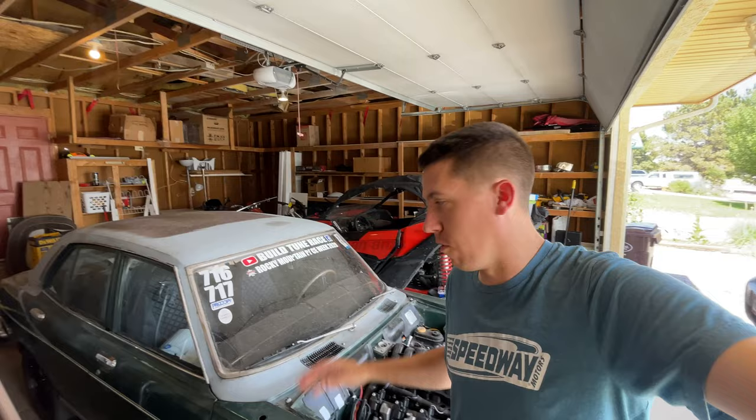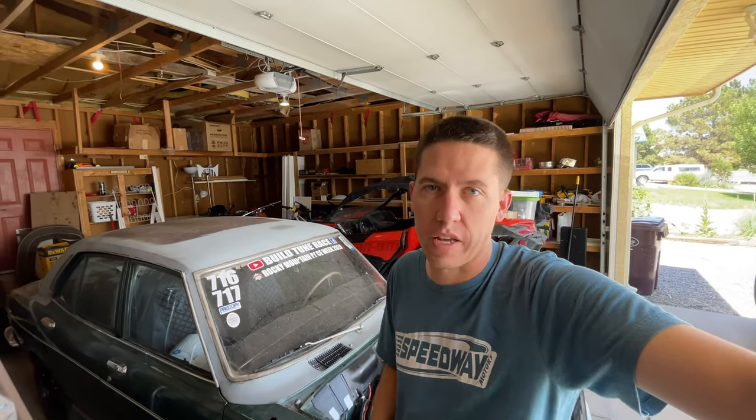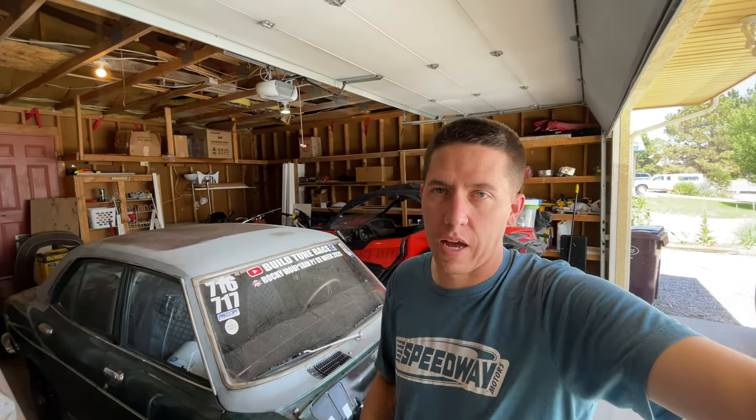Should be good to go, as long as the transmission holds up and doesn't get knocked out within a short time. First time it lasted 5,000 miles, second time 3,000 miles — maybe we can get 1,500 out of it. Little update on Clyde: he did make it to the free car event but we weren't able to make any passes because the transmission still leaks — not as bad, but because of that crack in the tail housing it still leaks. We definitely need a new tail housing, get the driveshaft balanced, and hopefully that fixes everything so we can do some upgrades and more fun stuff. More Clyde updates coming in the future — hit that like and subscribe button, we'll see you next time.